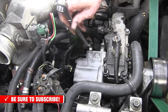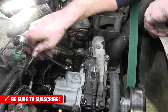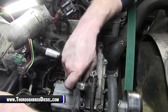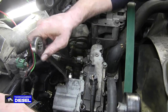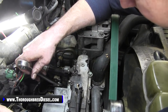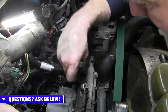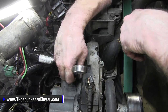Both lines are now disassembled at the heads. We're going to go ahead and remove the fittings and lines at the pump — three-quarter inch again. We'll do the passenger side head first, which is the one closest to the turbo. We're also going to be removing the check valve out of the high pressure oil pump. We want to do this portion of the installation as quickly as we can, being conscious of not getting any dirt down into the Rexroth pump and causing damage.